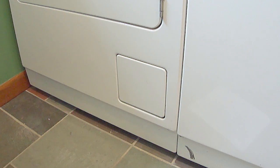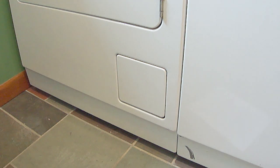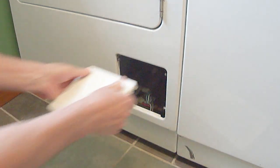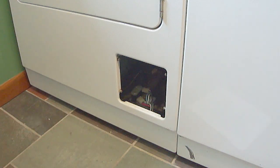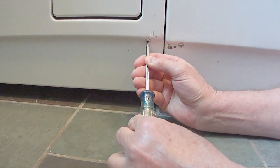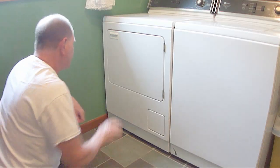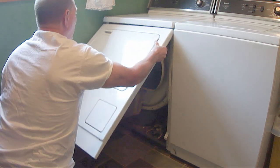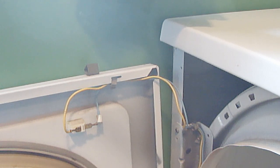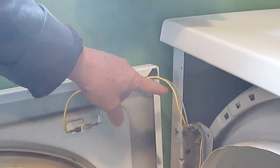As you can see, this dryer has a large door that can manually be opened. This can also be removed. If you do not have a flame observation opening, then you'll need to remove the front cover by removing the two screws located at the bottom of the cover here and here. Next, tilt the front cover upward which will allow the top clips to release, then carefully set the cover to the side. Be advised that there will still be wires attached to the front cover like you see here.